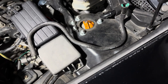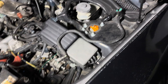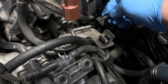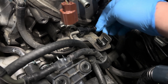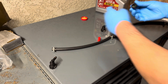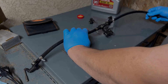As expected, just like in the ChrisFix video, we can't cut into here and put our ethanol sensor. But that's why they give us our customizable kit with the upgraded hardware — it's better hardware than these little old-style retainer clips. So we're going to get the new stuff on here and build our kit. When it comes to the quick connectors, there are two sizes: one for the fuel flex that connects to the rubber hose and ethanol sensor, and ones that connect to the Honda lines. You want to hear it click and you want little to no play — just like that, that's perfect, bulletproof right there. When making your custom fuel line, it's extremely easy and you get all the necessary components in the kit. Put a little bit of oil on the O-rings, and also when you remove the red cap on the fuel flex sensor, put a little bit of oil on the surface and you should be good to go.